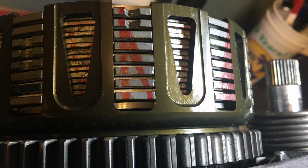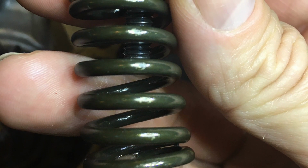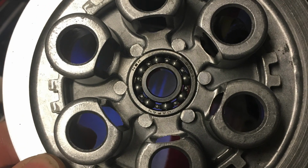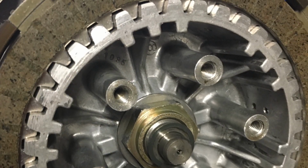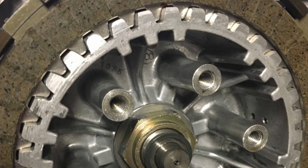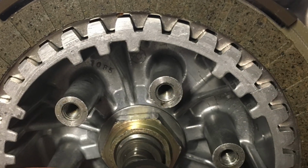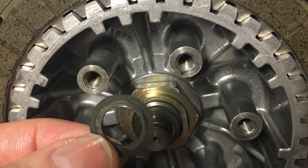That's obviously the clutch. I literally was so anal, I put markings on the plate stack so I could kind of match it back up like a puzzle. Not that there was anything magical about that, but taking a lot of pictures makes a big difference. This is the top cap or pressure plate of the clutch. I wanted to get pictures of how everything looked through the whole process. And you can do it yourself, if you get the right tools and you just be very deliberate.